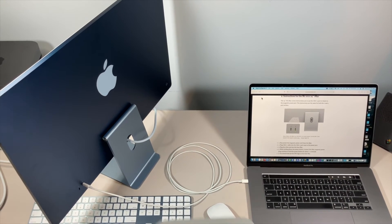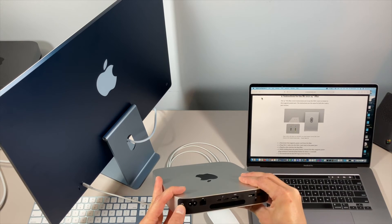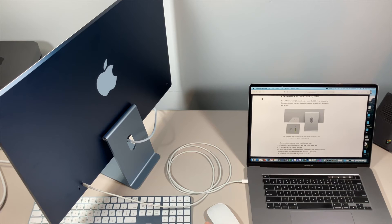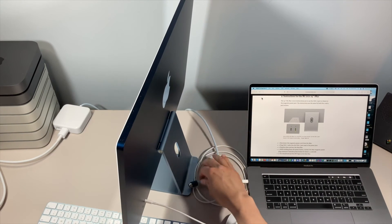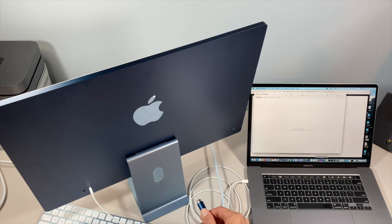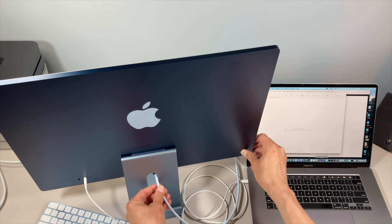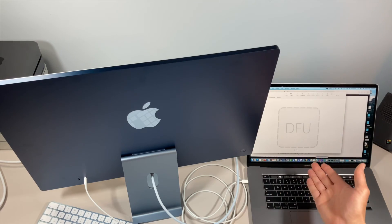Once the cables are connected you're ready for the next step. This is very similar to how you do it with the M1 Mac mini — on the Mac mini you connected the cable and held down the power button, and it's the same here. All we need to do is remove the magnetic power cord, give it a second or two, then hold down the power button and reconnect the power cable while holding it. I'll have Apple Configurator 2 open so we can see exactly when we're in DFU mode.